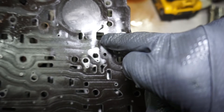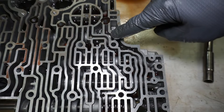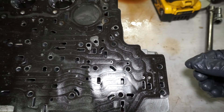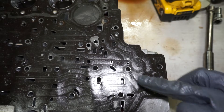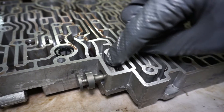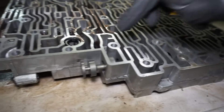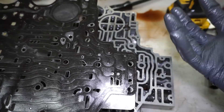Third gear feed comes in through this big square hole. Third gear oil comes in this way, blows the check ball over, and fluid comes out through the same circuit. This banana passage feeds oil over to the one side of the hole in the center support, which feeds the piston. But when you remove the second sealing ring and you remove the lip seal inside the drum, you're also feeding oil back through this hole — that's why you need to plug it. Otherwise you're going to send fluid back through the reverse circuit all the way through, and when your manual valve is in the D3 or drive position going into third gear, it back-feeds fluid through your reverse circuit, creating a big leak at the manual valve. If you don't have that hole blocked in third gear, some of the fluid will get back-fed through the low-reverse circuit to the band circuit, just creating a big leak. By blocking that hole, you can feed third gear oil to the whole piston without back-feeding fluid, and you don't have a leak.